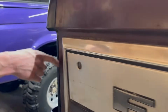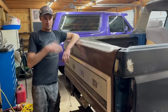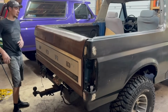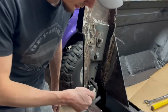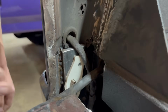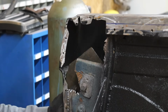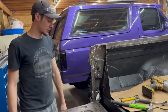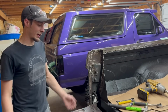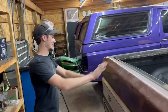There is a little bit more of a gap than I would like, but honestly, I don't care because it's got a clean tailgate. And if you guys seen the previous video, I could shove like my whole hand in there, and this side was overlapping the quarter panel. So come in here, cameraman, I'll show you what we had to do. Actually, it's what my cameraman did for me. We had to make a spacer here, about a 1/2 inch spacer, to move the hinge out away from the quarter panel because, again, in the previous video, this is all obviously not factory. This is from yours truly, and I didn't have like a lot of previous measurements to go off of because it was like gone. So kind of guessed, got everything lined up, and that was off about 1/2 inch. So we made that, or my dad made that at his work. You are welcome. And now it lines up freaking sweet.